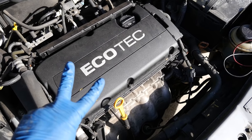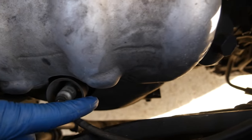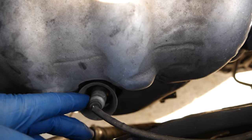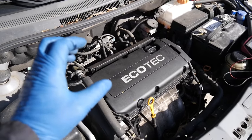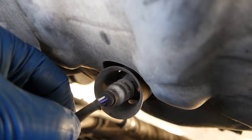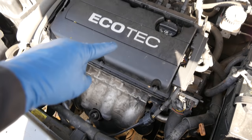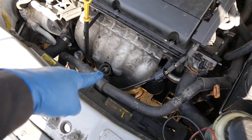On a four-cylinder engine, you're going to have usually two O2 sensors — one pre-cat O2 sensor, which will be the first sensor before you get to your catalytic converter, and then another O2 sensor further down past your catalytic converter. The job of your bank one, sensor one, or pre-cat O2 sensor is to sense the amount of oxygen in your exhaust fumes, and then your car's computer regulates the amount of fuel entering your engine via the fuel injectors. Your oxygen sensor is a voltage-producing sensor — it measures the difference between oxygen in the atmosphere versus oxygen in your exhaust gases. The greater the difference, the higher the voltage produced.